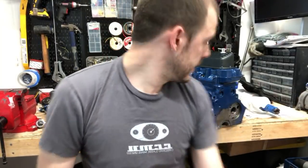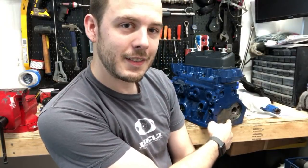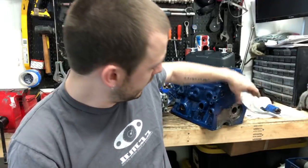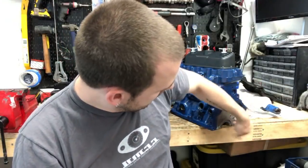All right, looks like I got a few messages here. Megadite, that's not the clutch side. This is definitely the clutch side, definitely. So your transfer case sits on the side, comes down, connects to the end of your crank on the main gear, transfers down to your clutch, and everything is down here.